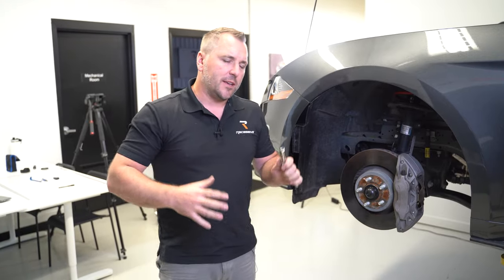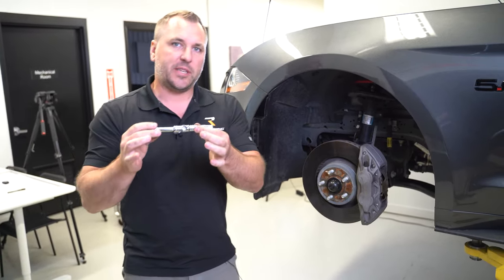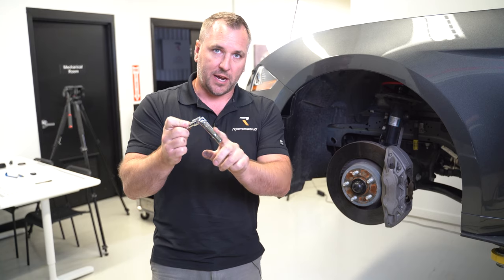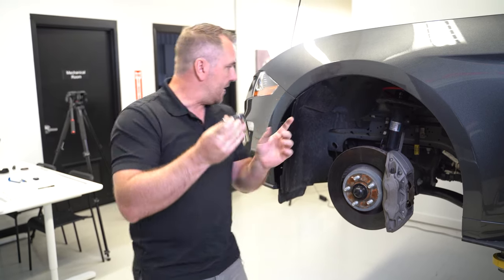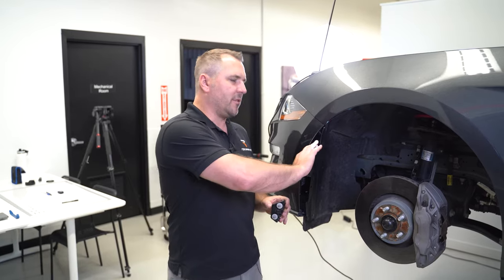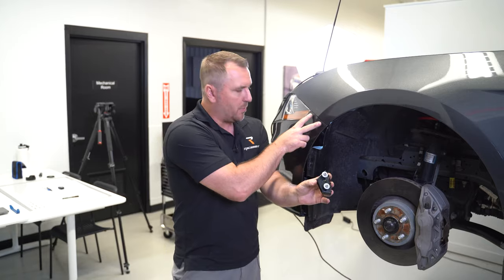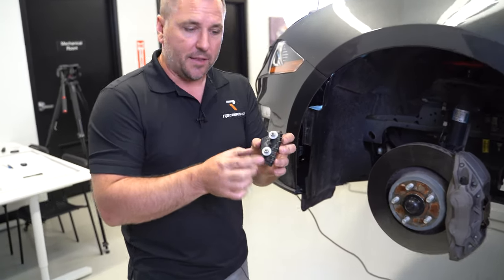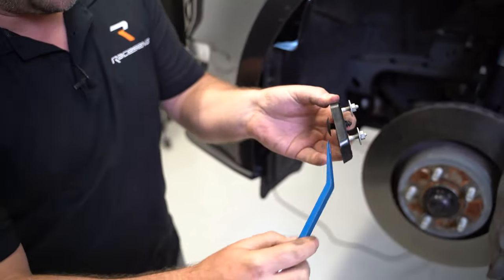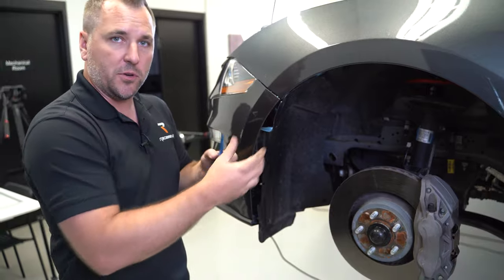After those clips are removed, pull the interior fender liner back away. Use a specific stack-up: a three-eighths inch drive small extension to a swivel to a 10 millimeter socket — this lets you reach a nut that's up under the fender liner. Make sure you peel the liner back far enough to access this part tucked under the side of the bumper. Remove two nuts and one plastic fastener up in there, using a pry tool from underneath to pry it down. The bumper side will drop loose. Repeat this step on the other side of the car.